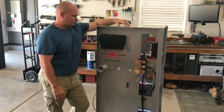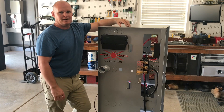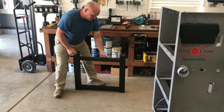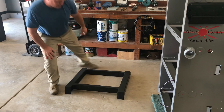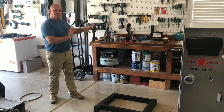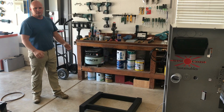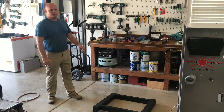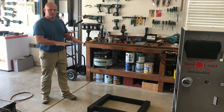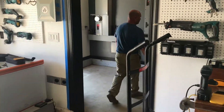That data is going to tell me whether I have a problem or not, so I'm super excited to start this. I have a lot of time building this rack to get to this point. We also had to build a custom base for the battery rack because the power room has some slope. I built a kind of prefab base that the rack will sit on — we'll trim the feet to make it level and sit flush against the wall so we can bolt it securely. I also needed to raise it up a little bit to fit the factory holes with my gutter.